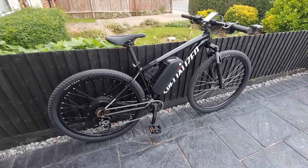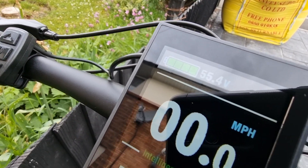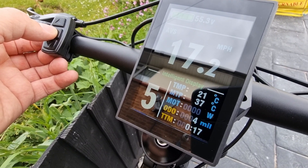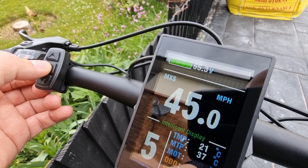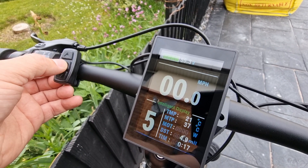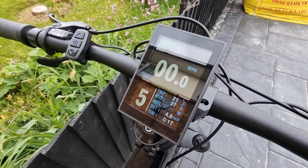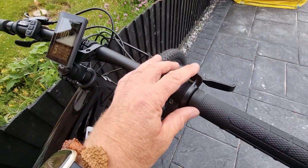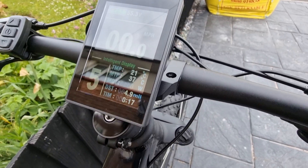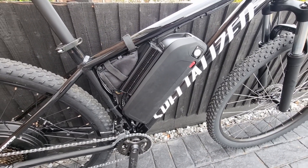It's got a little bit windy guys, but it is done. Hopefully you can hear this mic. Taking it for a quick test ride, about five miles — the battery wasn't fully charged, but it was all right, it's decent. Maximum 45 shown, though I'm pretty sure I saw it do 38. I might have spun the back wheel up with it off the ground. Being totally honest, it's done about 38 — that's probably about right. Throttle only without pedaling, without being down a massive hill — probably do over 40 down a hill. Lock-on grips, level assist, power button, color display. 20 amp hour, massive 52 volt battery — I think that's about 1,040 watt-hours. Controller, painted in black.